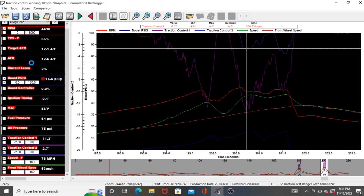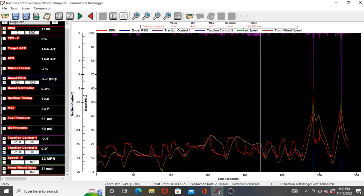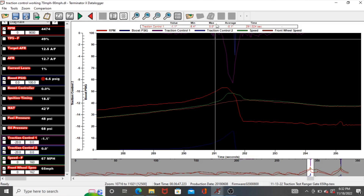Let's look at the 70-to-90 log. Up at the top you can see this little purple line — it's kind of tickling the traction control as I'm cruising. It's not pulling a lot right here, but you can see it's actively working — only pulling about 0.1 to 0.2 degrees, no more than a quarter to a half a degree up there. Here same thing — we have 62 and 61 mph and it starts to deviate; it's pulling timing here. At 65 miles per hour front wheel speed and 67 rear, as it starts to pull away two miles an hour of wheel spin, it's pulling one degree.